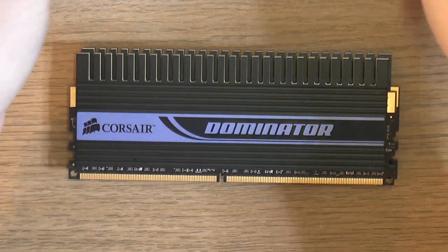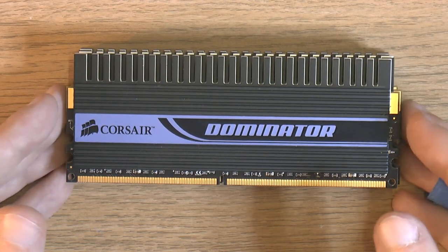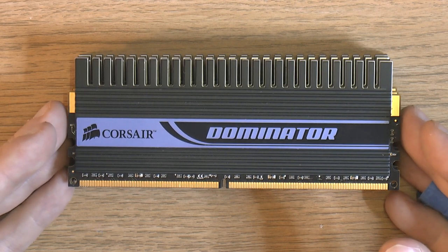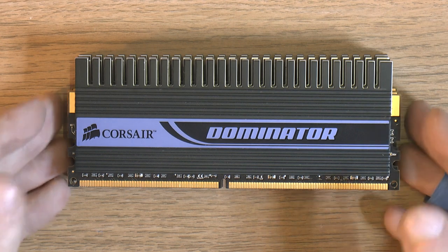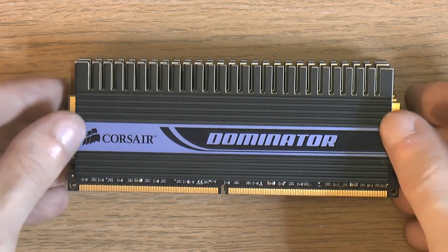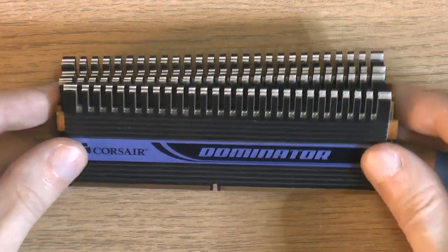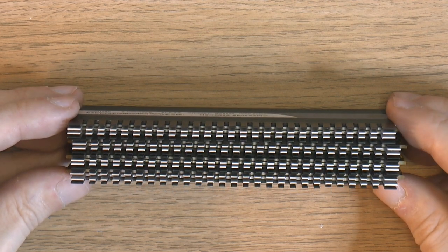The CPU and motherboard are only rated at 800 MHz. That's because on the AM2 platform the memory controller is in the CPU, and it can only have dividers up to 800. You can overclock the bus, the HyperTransport bus, the base clock, BCLK, and lower the multiplier. That way you can force up the memory clock.